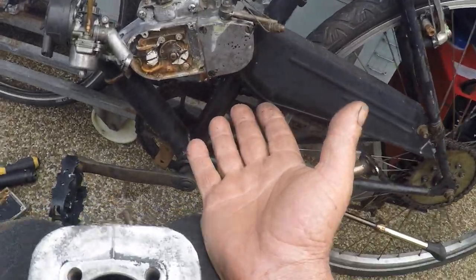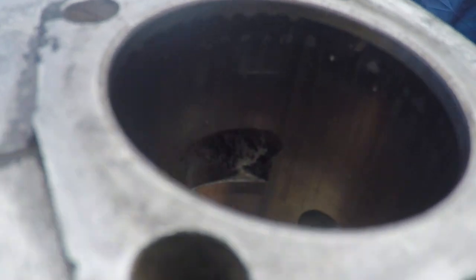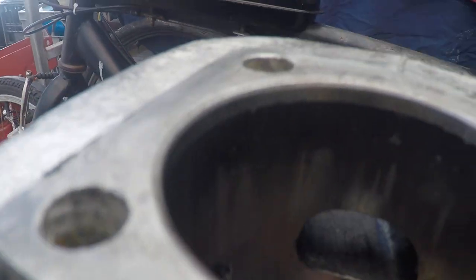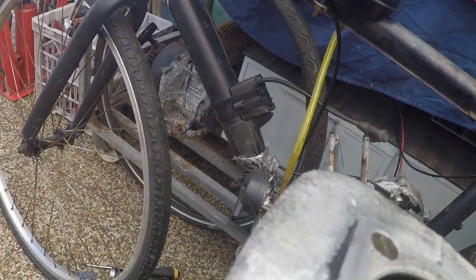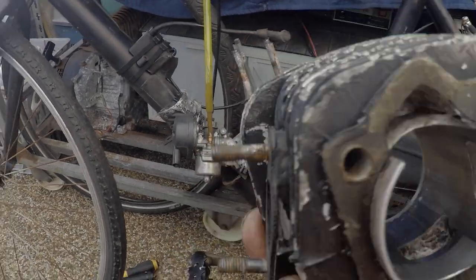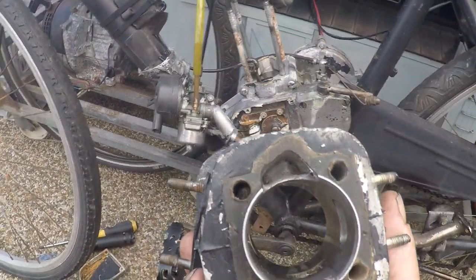This is 8 years old, and actually the bore and the piston are perfect. Well, I've still got hone marks. Maybe you can see them in there. I can't remember exactly the port, but I'm sure it's only about 21 degrees down from the exhaust, which is 153. I was aiming for 150. You don't need any more than that because it won't breathe any better than that to give you a top end.